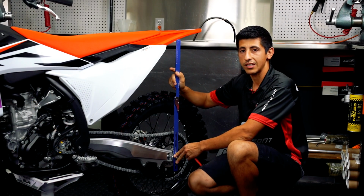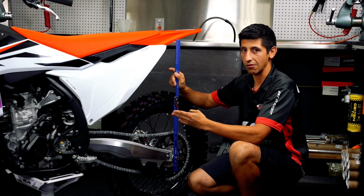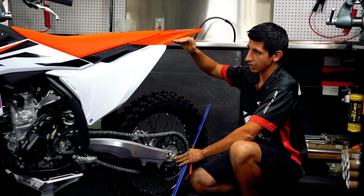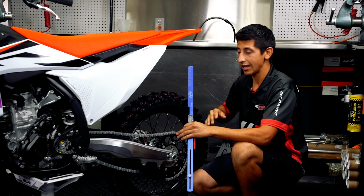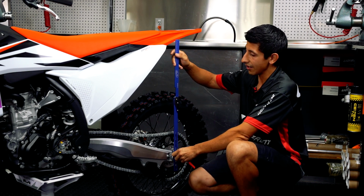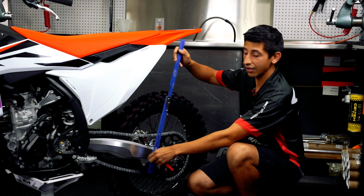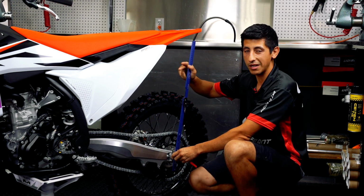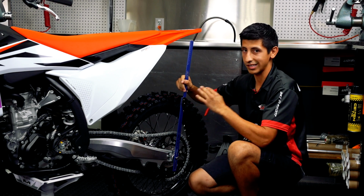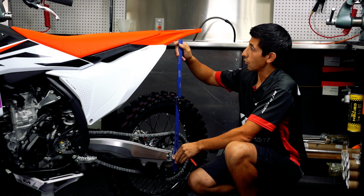When it comes to set and sag, we're going to first start with getting our zero, basically meaning our full extension. What is our full extension? We want to pick 2 points that are fixed. We don't want to check here and then the next one check over here. We want to be checking at the 2 same points at all times for our data to be consistent, for our numbers to be the same. So we're going to get our zero.